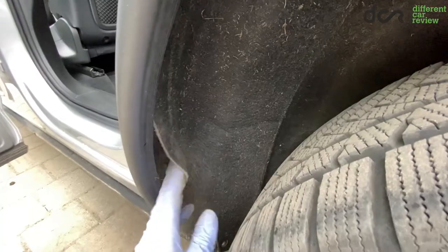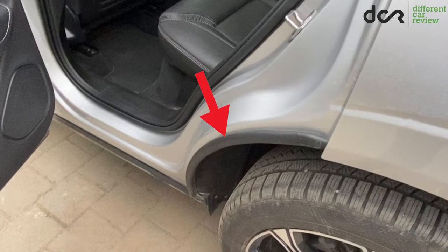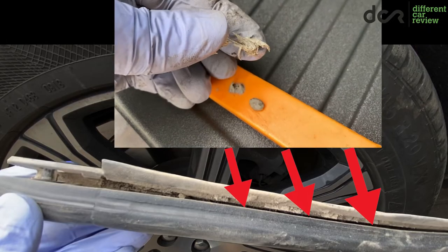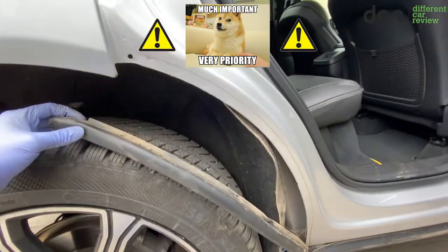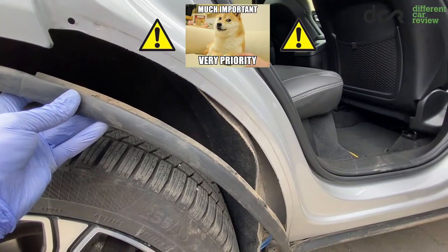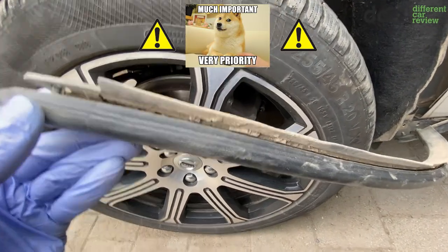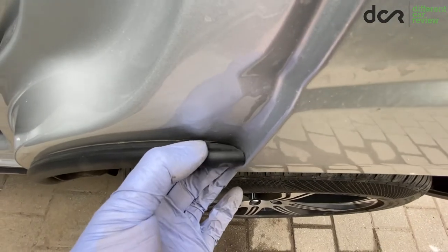After this, you can unfold the fender liner in this place. Then there is the rubber seal. Before removing this seal, I have to warn you that inside of this seal there is a sticky sealant. This means that if you remove the seal and later put it back, it most probably won't sit in place as tightly as before, since you damaged the sealant and dirt gets trapped in it. So if you don't have time, tools, wax, or some sealant to put instead of the old one, then you should leave the seal in place. But in this case, let's remove it.